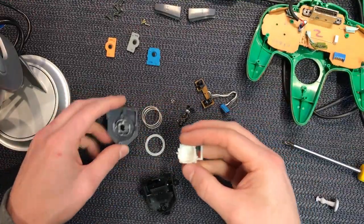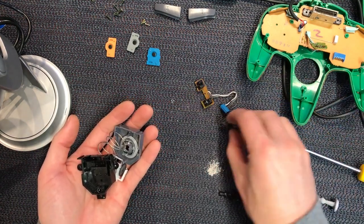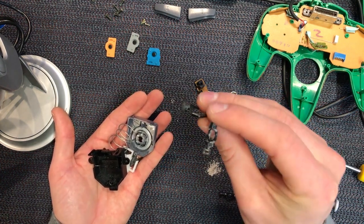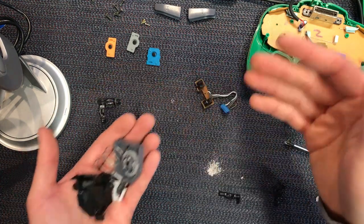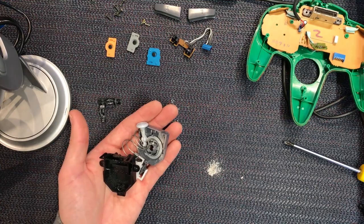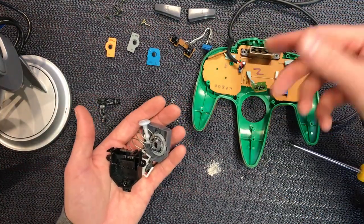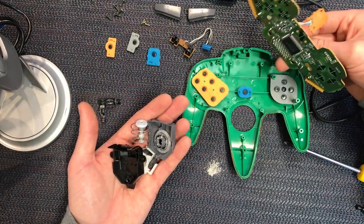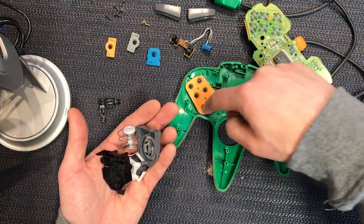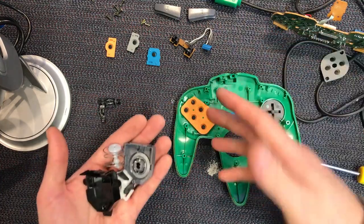I won't show the washing process because it's pretty boring — just wash all the plastic parts separately. Even the ring, even the spring if it's got powder on it. We're not going to use the original worn parts anymore; you might get away with tape or super glue but they're really disposable and I wouldn't bother. Wash the joystick and the plastic controller parts as well. The board itself you should lift out of the controller — these are the contacts we're going to clean with isopropyl alcohol. Pull out these membranes and we'll wash the whole thing.